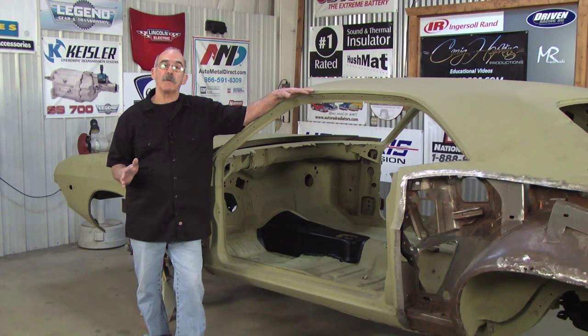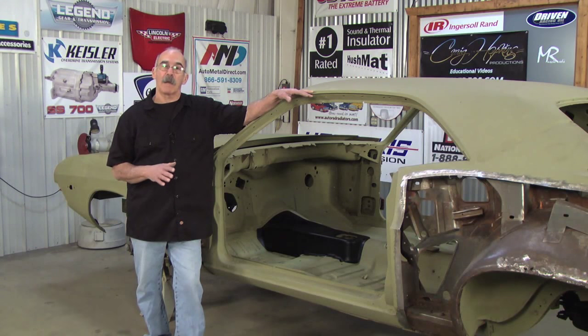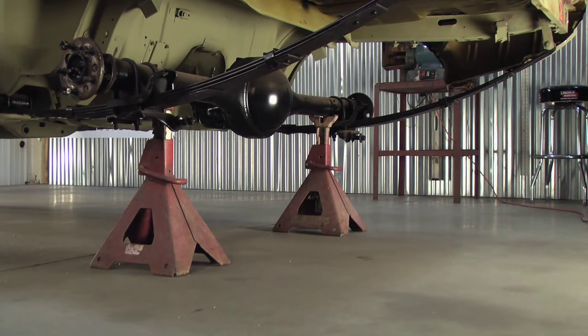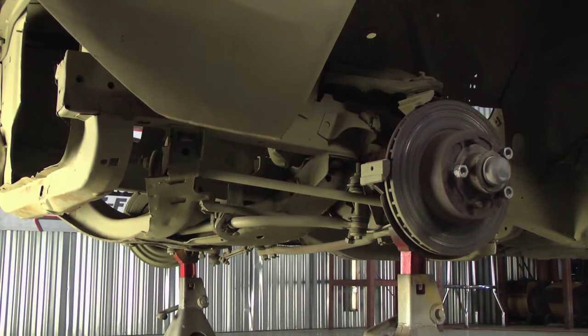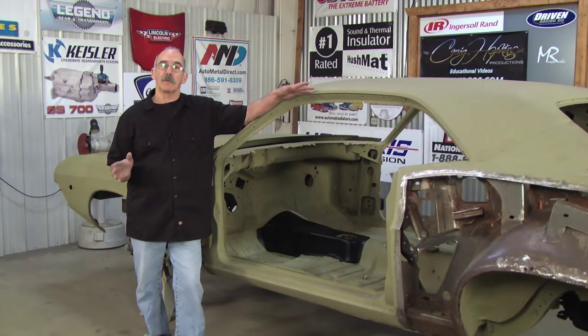If you're gonna do this in your home environment, the car should be properly supported. We have it on jack stands and the car is level. Underneath the rear end I'm carrying it right in the center to duplicate where the wheels would sit, and the front also under the ball joints. This keeps the car from drooping on either end or bagging in the middle. If the jack stands are on the frame rails at the front or back, the car will want to collapse in the middle; too far up on the rails and it'll droop on either end.